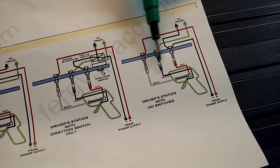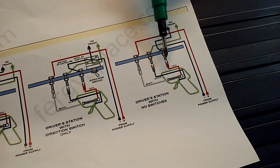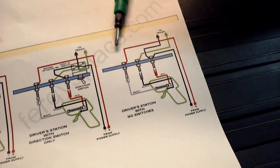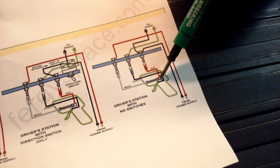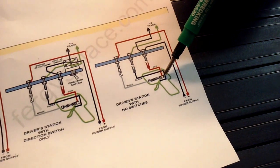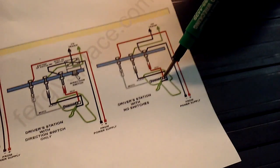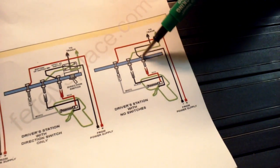If it's a 3-wire, your controller has to be a 3-wire. So what happens is if it's plugged into here and you go into letting the brake off, or letting the gas off all the way and going into the back part of the rheostat, from what I'm understanding, and how true this is, I don't know, if anybody wants to correct me, that's fine, that just reverses the polarity for just that split second and then goes over to here.